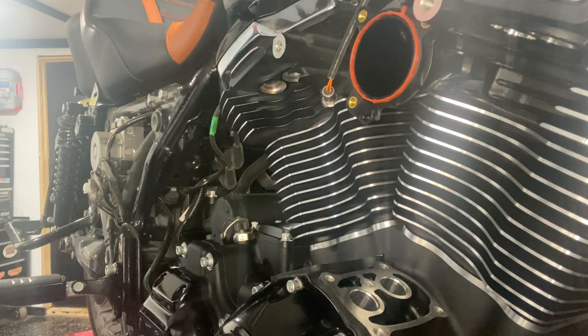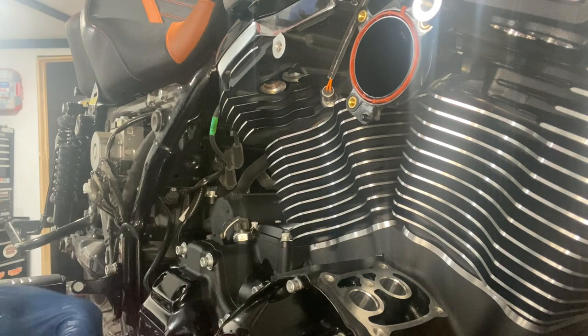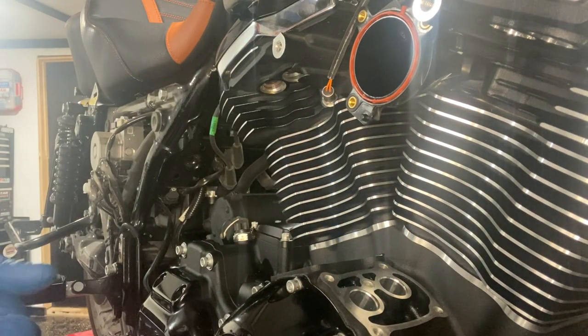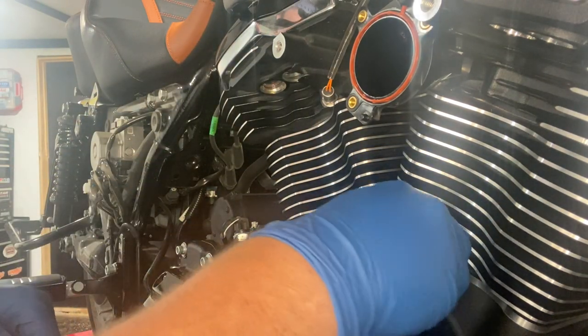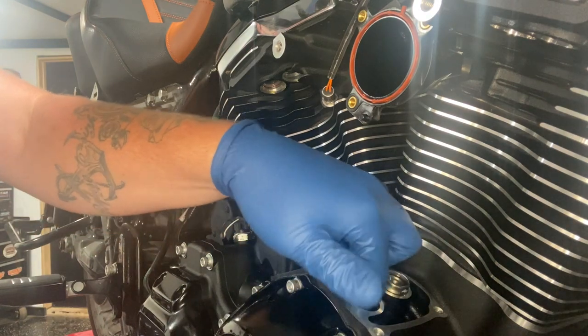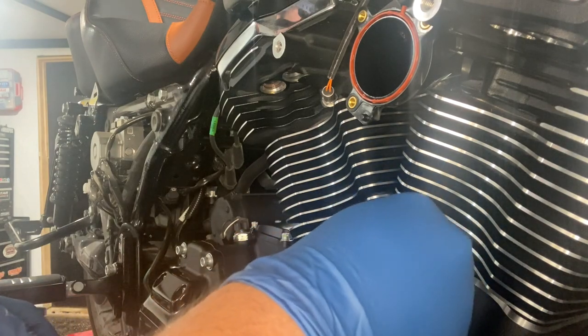All right, now that you're a little bit closer, we can get up close and visual. You can't really see this side, but you can definitely see the front cylinders. So we'll start there. So first, you're going to get your lifters out of your oil that you're soaking in. And then we're going to go ahead and get some oil in the bores, just that way we know they're ready to rock. And we're trying to carefully set the lifters in place. You don't want to just drop them in. Try to carefully slide them in place.